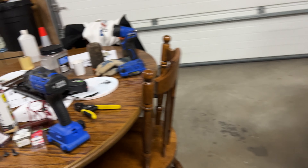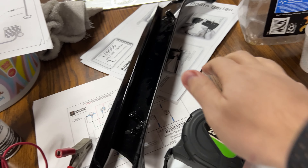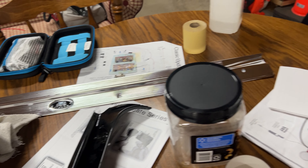If you look over here on the table, we've had wiring diagrams. We've been studying everything, trying to get it all figured out. We think what happened was we were missing one of the ground wires going to one of the gauges back here and then running to a ground in the car. We were in a rush trying to get the car to Pigeon Forge, and it's just something that we probably overlooked.